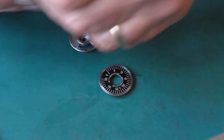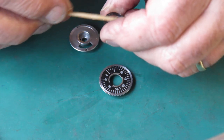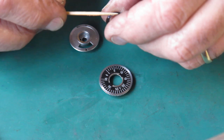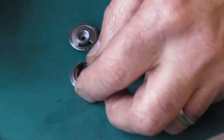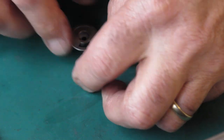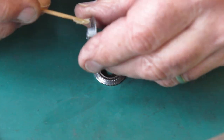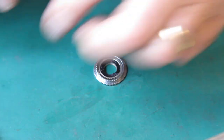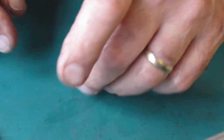The wavy washer sort of hacks to give us a controlled slippage in there. Let's put that synthetic grease in there and let's put a wipe around here. This sits on there like that.